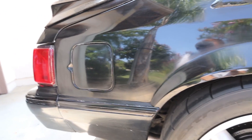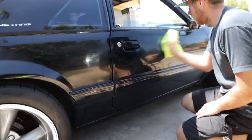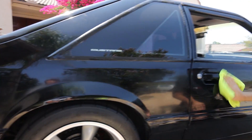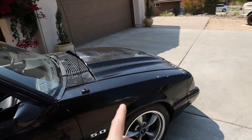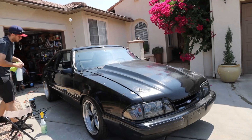It's definitely been wet sanded already and I think they started buffing it but never totally finished to the polish state. The panel's smooth which is cool — no orange peel, but you can see the chalkiness and the sanding lines. So it's basically removing those and polishing the whole thing out. Going front to back and polishing out what's foggy will make it easy to tell what's savable and what's not.